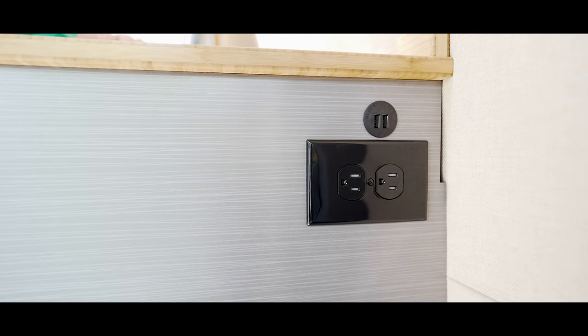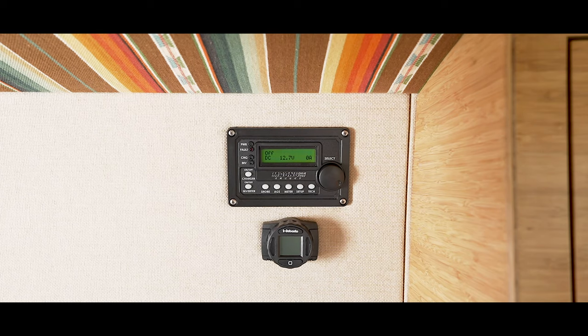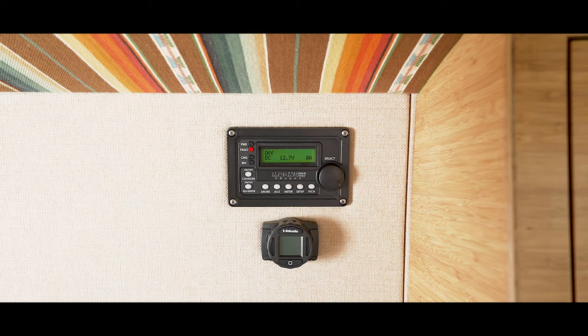Since I haven't plugged in any appliances yet you'll see that the output is zero amps. Now let's plug in an electric kettle and see what happens. The output is now showing a negative number of amps. After you are finished with your desired inverter use, simply turn it off by pressing the inverter button. The fault light will only come on if there's a significant fault with either your output voltage or your input voltage. If your batteries have completely run out of power your fault light will illuminate. If this happens you will have to charge your batteries before the fault light will go away. If the light persists, contact the service and warranty department at Outside Van.